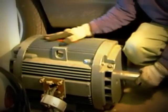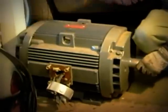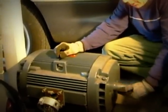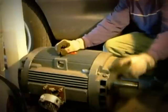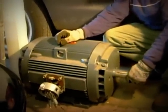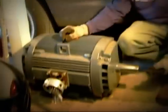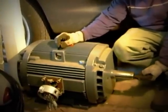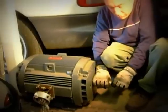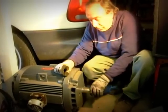This is the baby — a 30 horsepower AC motor using about 75 amps when normally running. This is going to fit onto that bracket we made outside. On this shaft here, we're going to put a pulley to run an alternator, and then on the very end is where we are going to weld — yes, weld — the flywheel and clutch mechanism. The transmission shaft is going to have to fit in here, so in this end we're going to drill or mill a hole to put in a roller bearing. The shaft will fit in the roller bearing so it's supported from the transmission but won't actually turn this — it just keeps the shaft from becoming eccentric.